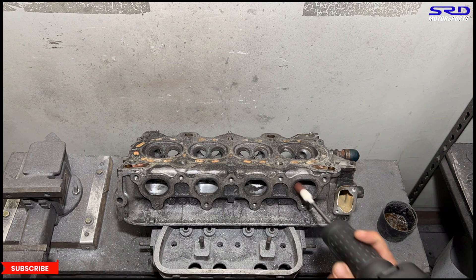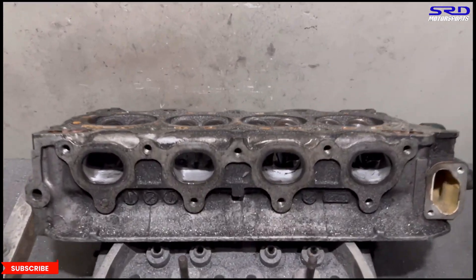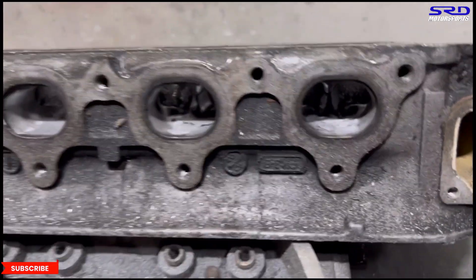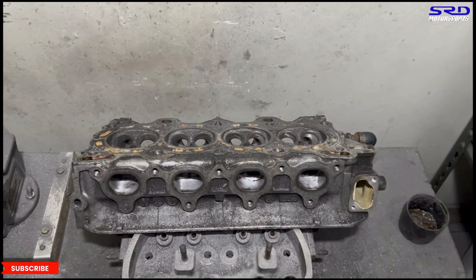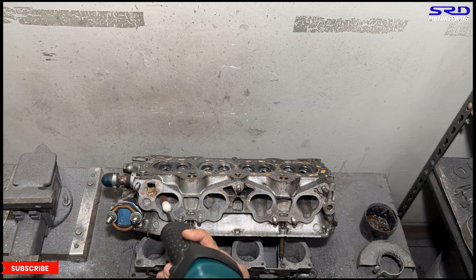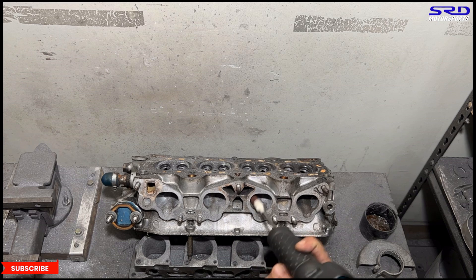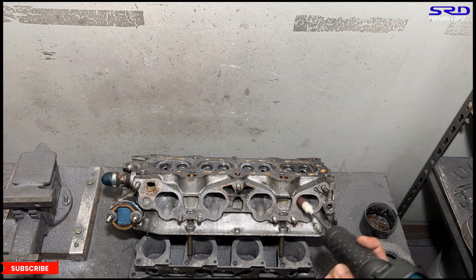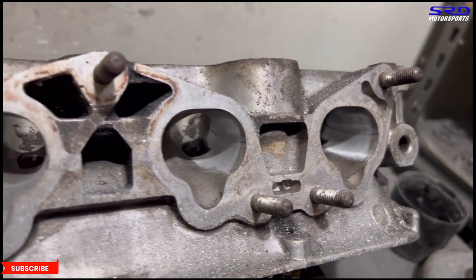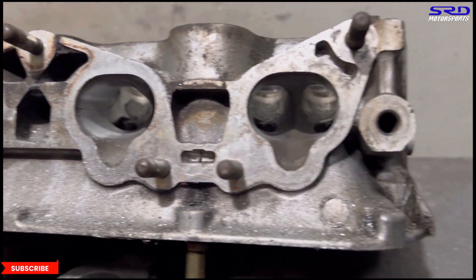It's starting to look really good now. Always wear a gas mask — we don't want you inhaling that dust. It's starting to look like good ported exhaust ports. Now, on the intake side, as we did with the carbide, we start with the port walls and blend slowly onto the roof — this way it's pretty consistent. I always do this step by step so I don't get lost and it doesn't become inconsistent. You can see the port walls are slowly blending well all together from the roof and a bit on the floor.